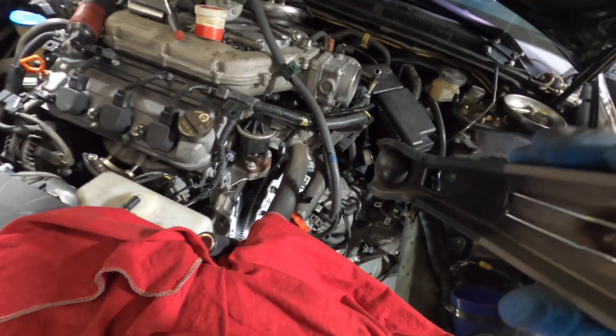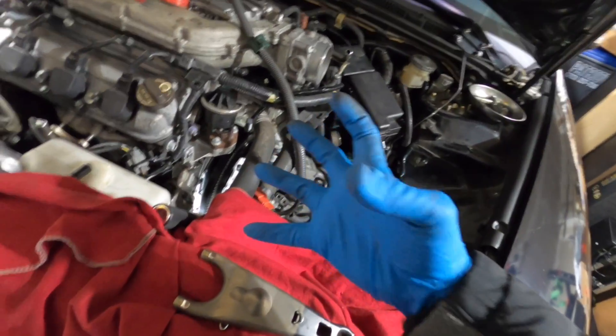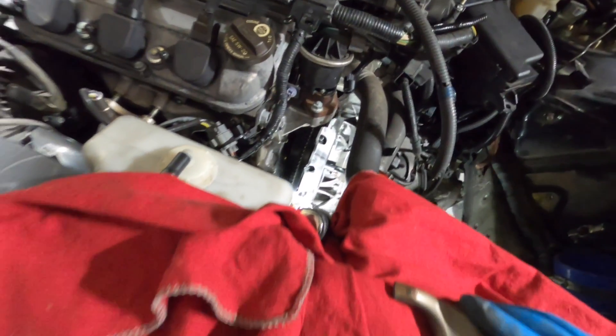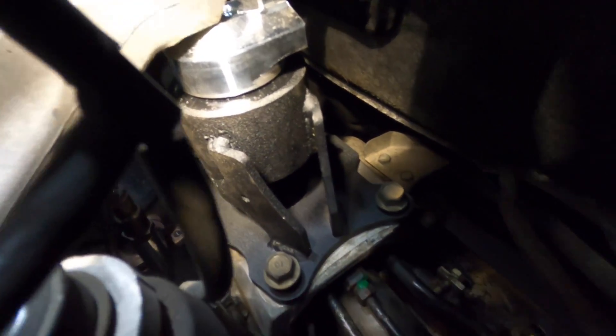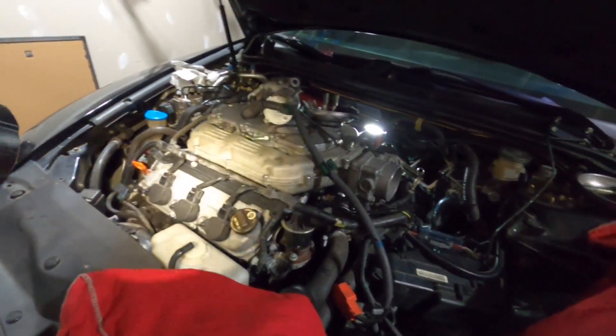Some of you may say to get the six-puck clutch, but I listened to what S&P Tony recommended. The six-puck or even three-puck clutch is just basically less weight — we'll see how it goes. Got the release bearing and release fork all in, all lubed up in the proper places. Got the new boot on. Using high-temp urea grease. Got the solid rear engine mount and solid front engine mount in. Now connecting the transmission to the engine, then all the engine mounts, side mount, and trans mount — putting everything back together.